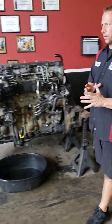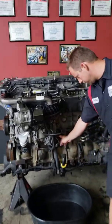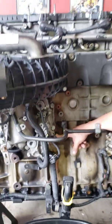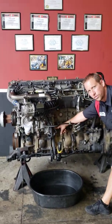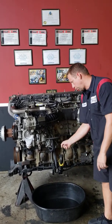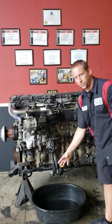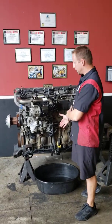The first thing you're going to want to do is drain your coolant. You're going to drain the coolant from this valve right here in the block — every truck has one. You're going to want to crack that loose; it takes a 19mm socket. Your coolant is just going to drip into a pan. We put a water hose on here so it drips into the pan without getting everywhere, but if you don't have one, just crack it loose and the water will drip down the block into your pan. Once you get that done, tighten it back up.